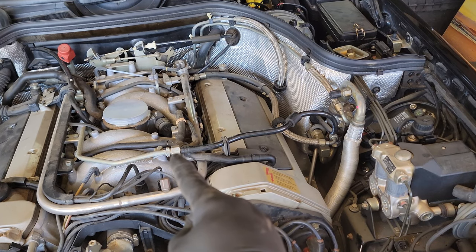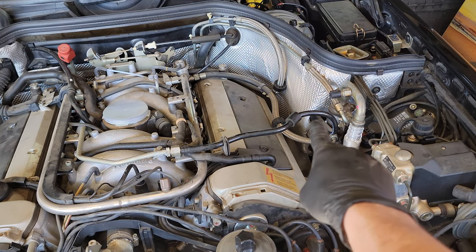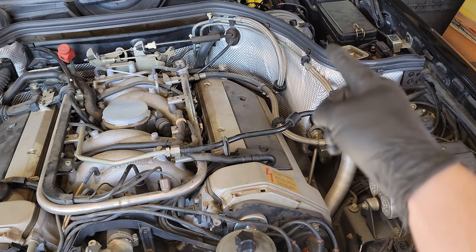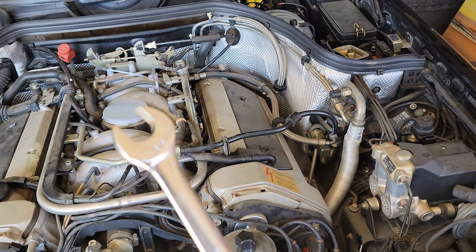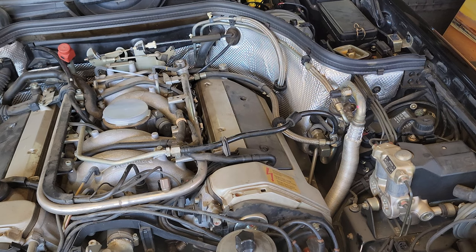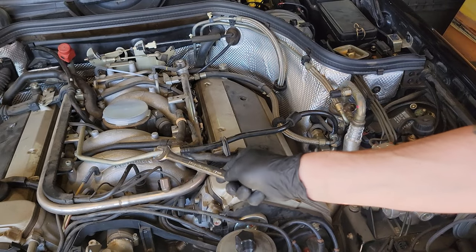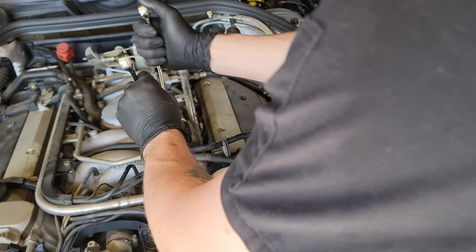I just thought the fuel cooler was cool — I'm looking at detaching fuel lines and I'm like, why is it going through the refrigerant line? It's a fuel cooler. Anyway, next I'm taking off this vacuum line here, removing it from that grommet. I'll probably have to remove the grommet and pull it forward because there's a check valve in there between that point and the booster. These are 19 millimeter — yep, 19. And I actually have the right tools this time because I brought them from work. It's a 19 and a 17.